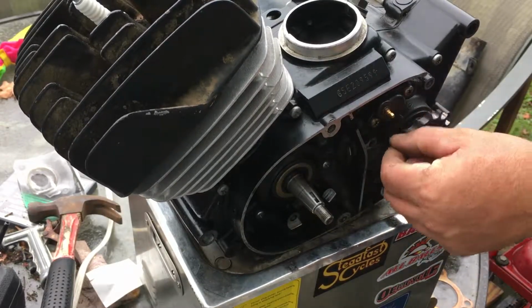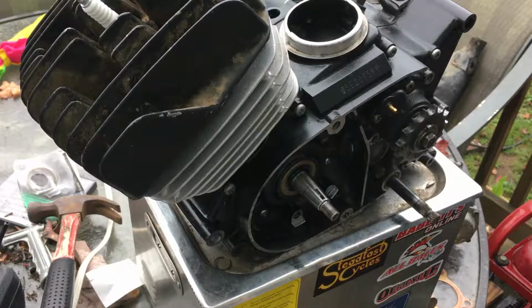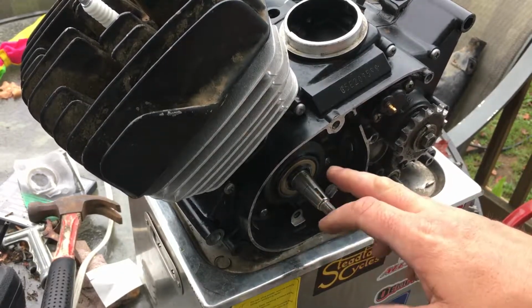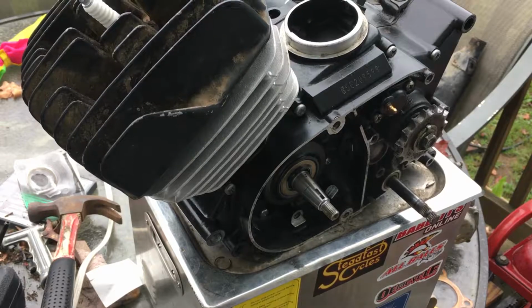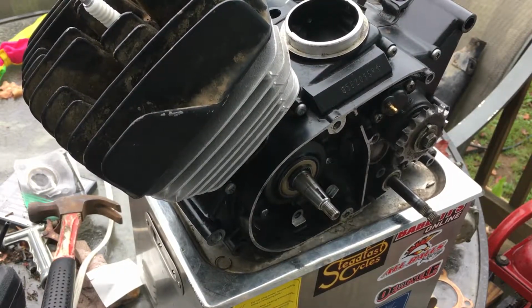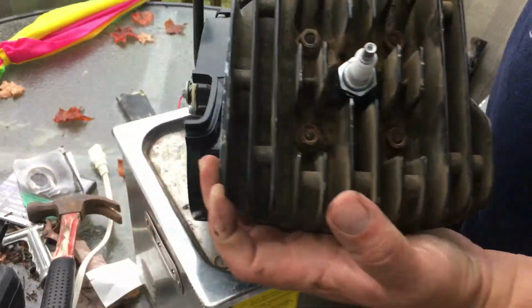So we're going to utilize every possible way to do that. This sprocket right here is new, just dirty. So we'll go with that, but we're going to retighten it because it's loose. So we'll take care of all that, zap that in, put the electronic ignition back onto it, do the side cover. There was this Kawasaki on the cover. That's going to be in the green. So I just figured I'd do the engine build first and get the pretty cool stuff done first, and then go from there. So we still have to mock up the exhaust this week. I got a few pipes I'm going to be cutting out to make the pipe I need, and yeah, I got some projects going on. I definitely got some projects going on.